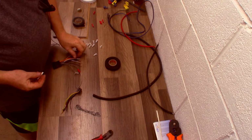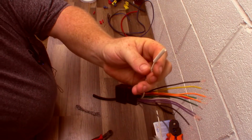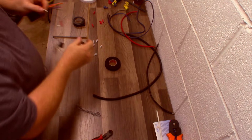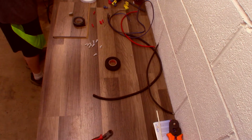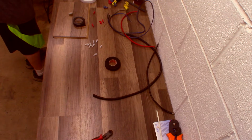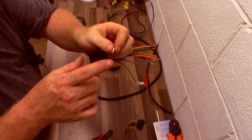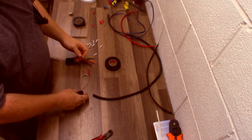When you're going to go with a heat shrink connection, you're going to cut a piece of heat shrink, slide the sleeve down over, like so, dip it into a little bit of flux, come over to your 1,000-year-old soldering iron. I don't know if I'm on camera while I'm doing this, guys, but I'm just doing a quick job for you so you can see it. And we are soldered. Okay, this is called tinned. Sorry, not soldered. I've now tinned the wire.